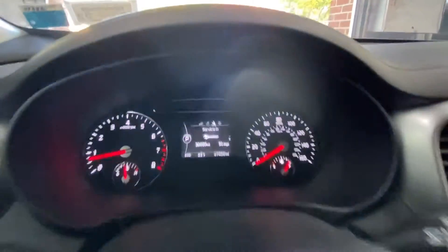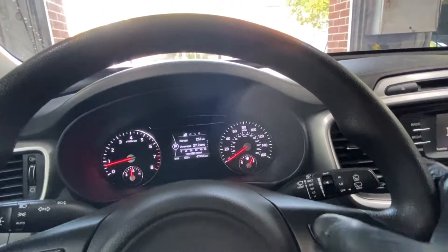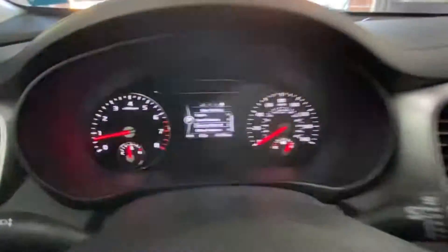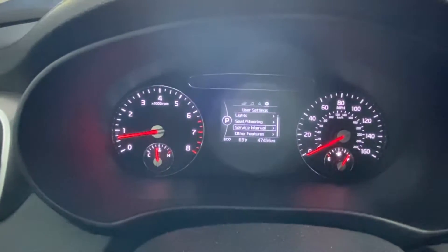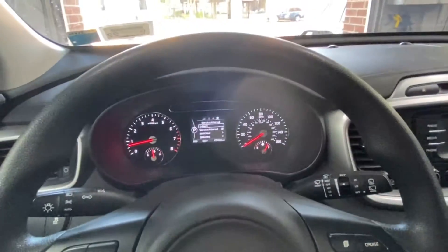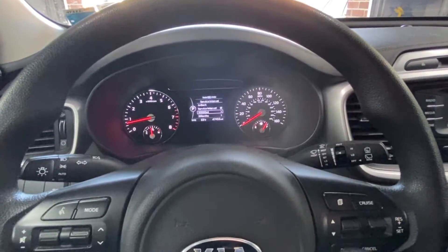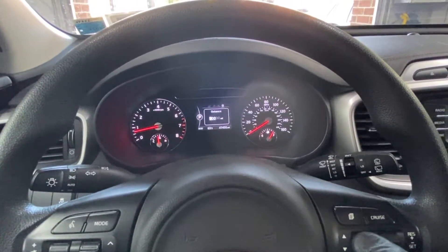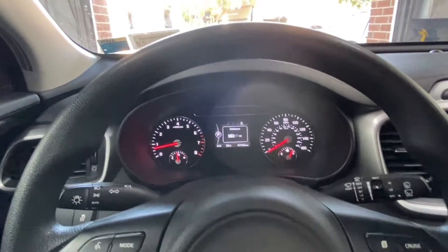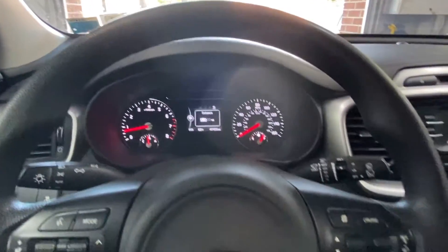So just the mileage — we have to go here, hit this button again, and it takes you to settings. From settings, you can scroll up and down. Go to 'service interval,' hit OK. As you can see, if you scroll down you can go to 30,000 miles, which is right now. You hit OK again and you can change that — when do you want the oil change. We're going to move one forward and change this to 3,000 miles, not 30,000 miles. And you hit OK.